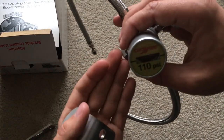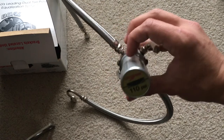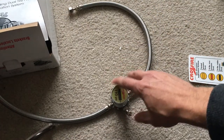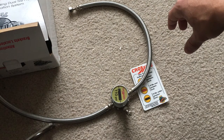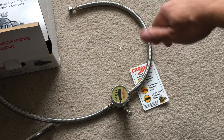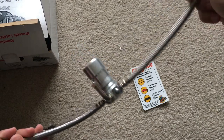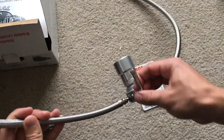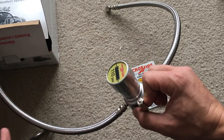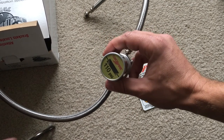Why do you want one of these? Based on my research, these come in very handy when equalizing tire pressure — hence the name tire pressure equalization system. If you have uneven tire wear on your duals, this helps. It also simplifies checking tire pressure: before, you'd check two tires separately, but now you have only one valve to fill and it distributes the pressure to both tires. You can quickly walk by, look at the gauge, and know if it's good or if you need to fill it up.